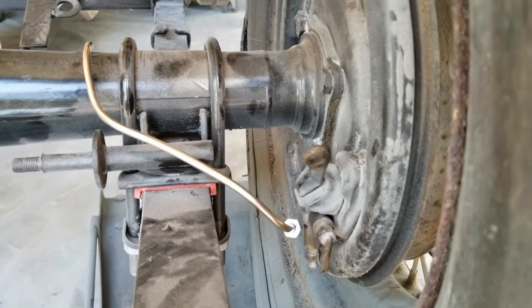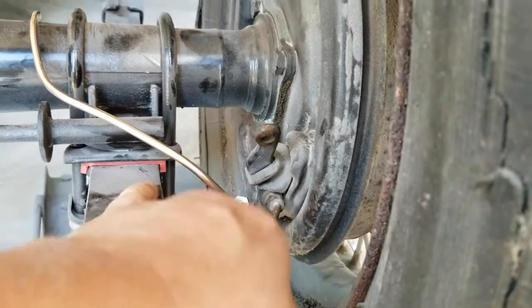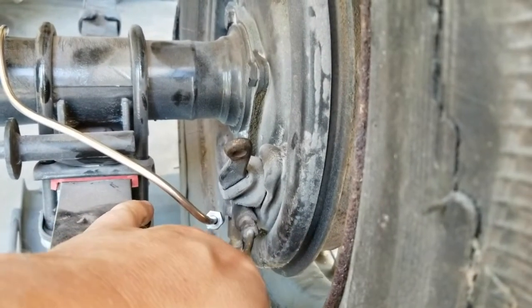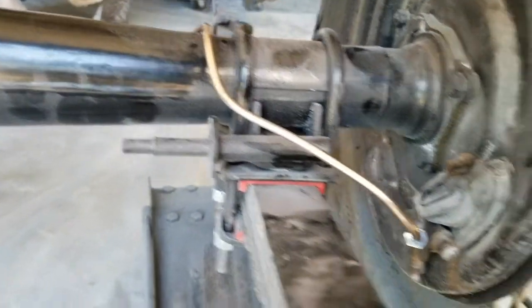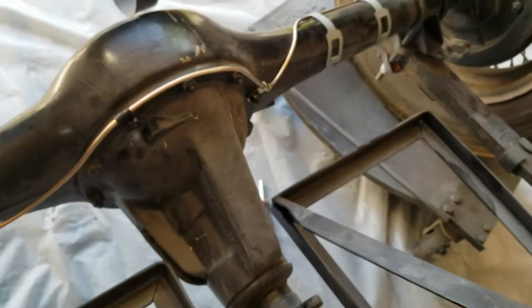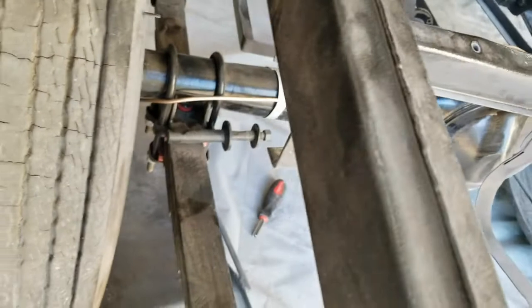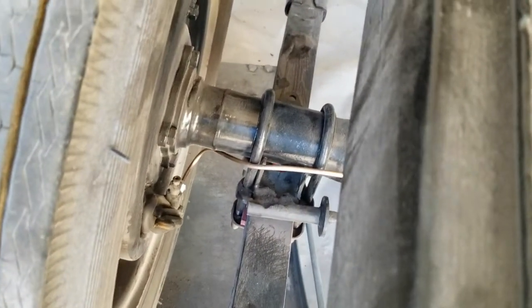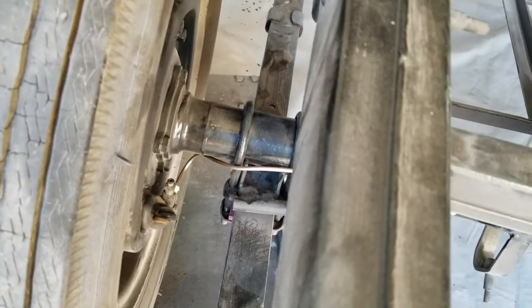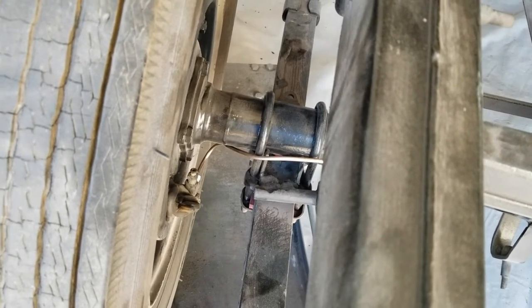Okay, so the rear piping is done. This is the right rear, obviously. I've not tied it into the banjo junction because it's already got a piece there. I want to replace that banjo junction anyhow, so who cares for right now. It goes up and around and into the three-way, which I've got over. A couple of P-clips in there, a couple of tie downs across the rear cross member. And down into the other banjo junction, which I didn't screw a whole lot into. I'm going to replace the entire brake system on the rears, and it'll be plugged into a brand new junction with a bleeder nipple and the whole nine yards. Not too displeased. This actually wasn't very tough.